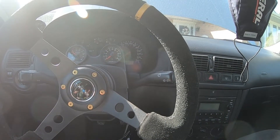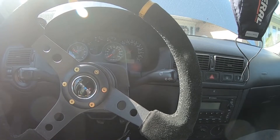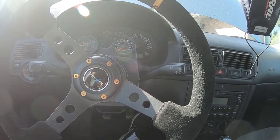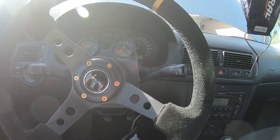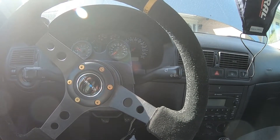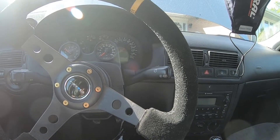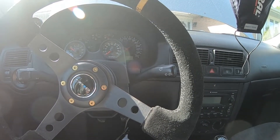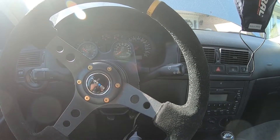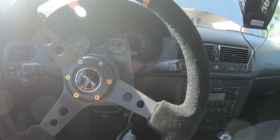Today we're going to take a lot of stuff off the front - the bumper, and the rebar, the metal reinforcement bumper behind the plastic bumper. We're going to do some measurements and work on getting ourselves a bash bar to get more clearance for the new power steering cooler setup, as well as reverting back to the original oil cooler setup with the fan and bigger cooler. I'll also start sea foaming the hardware for the turbo, since we're going to be getting that turbo replaced hopefully in the next coming weeks.